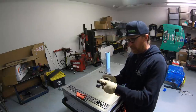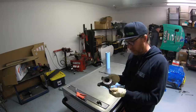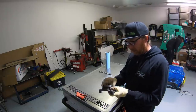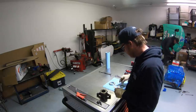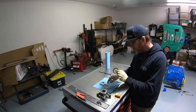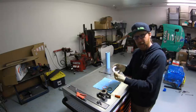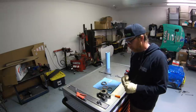Brakes are almost done. We have to run to GNJ one more time to get one brake line modified. We also have this slave cylinder that sits inside the bell housing — it's been used and been in the parts bin as a spare, but the bearing is a little blown out and who knows how good the seals are. So we're going to rebuild it: we have a new oil seal, a new wiper seal, and the bearing itself. We'll tear it down, clean it out, and put it all back together.